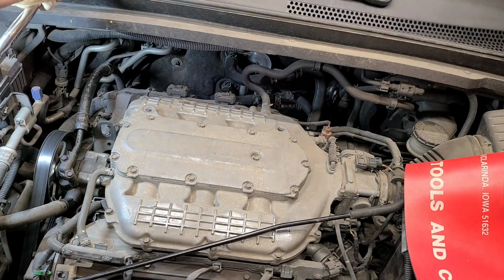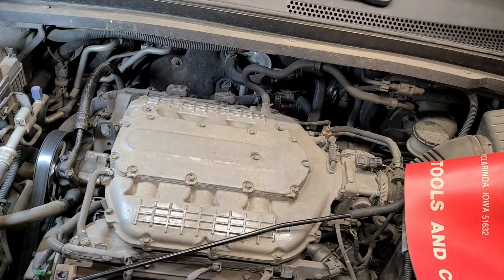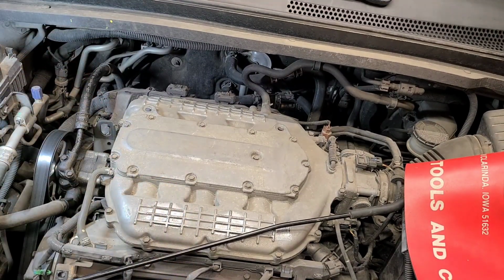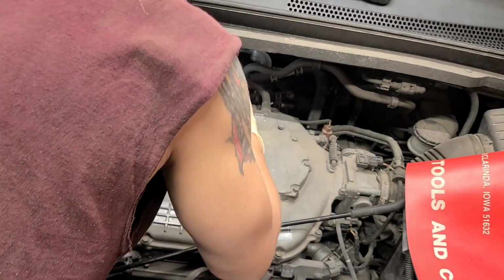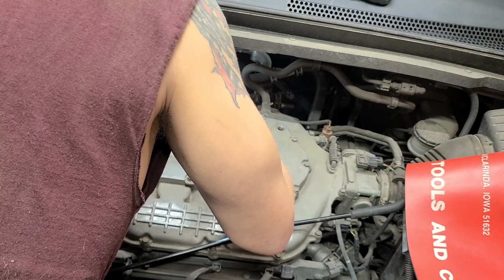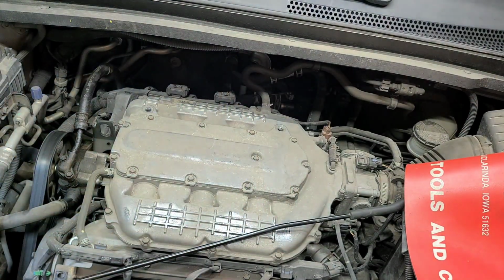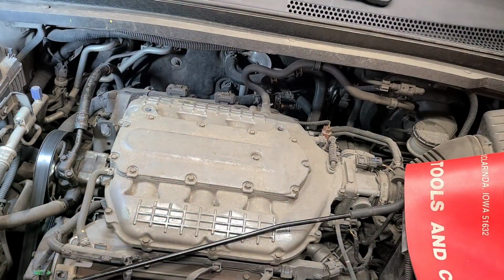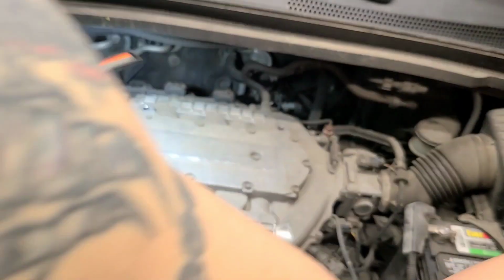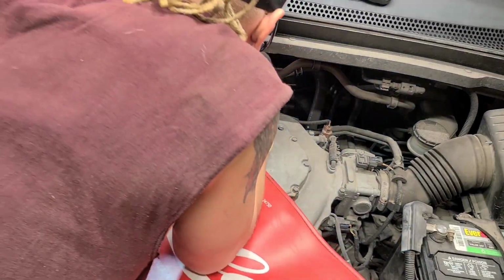And we're going to need at least a 6-inch extension, one of these guys, when we go down into there to get that. I believe it's a 5/8 spark plug, but I'm not quite sure, but 90% of the time it's a 5/8. And okay, don't even need that, so let's pop it off and make it shorter all the way down to the socket. Wish we had more magnetic spots to see better, but let's hold the light. Let's put this here for some protection. And let's get to it.